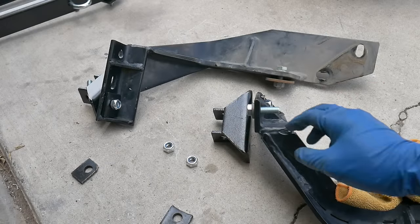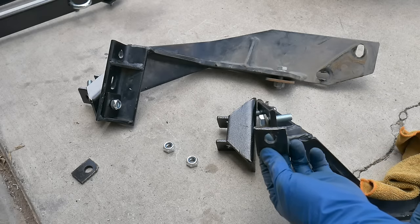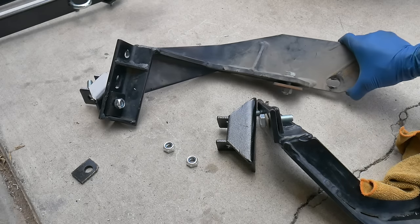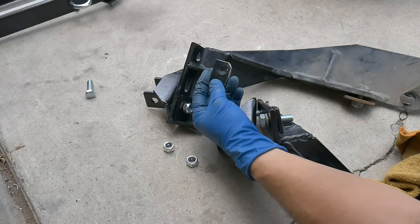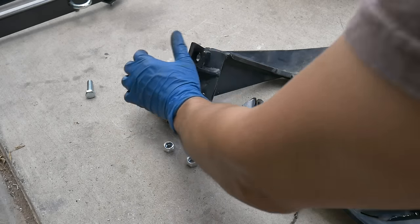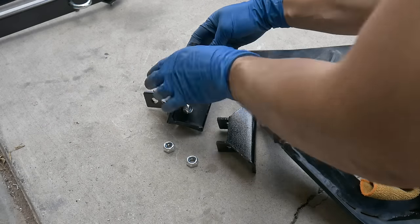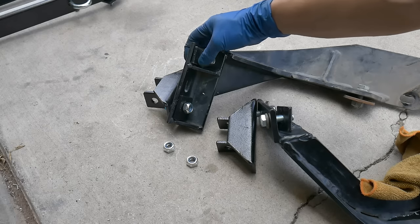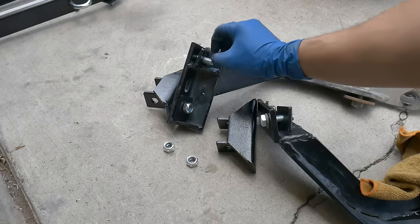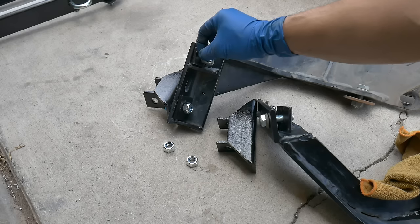For my particular application with my brackets, I just ground down a lot of that side so I can get this on there now — it fits perfectly, as well as this one. This one I had to do in a little different shape so I can match and get around the welds. I was able to have this one lie flat once we get the mounting hardware through there. It kind of serves like a large washer for the whole area and distributes the load more evenly throughout the entire bracket, which is why it's good to have those on there.